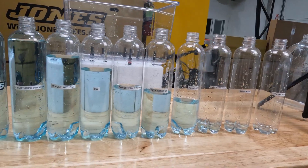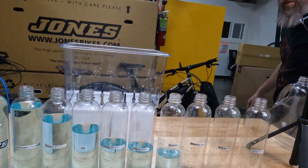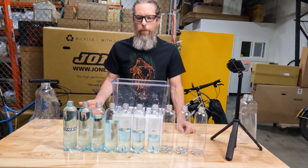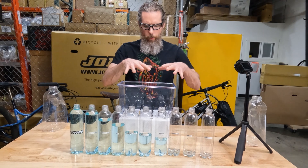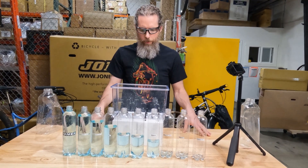When you're inflating a tire set up tubeless, it requires a certain punch to pop it open and make it fit — so flow really matters. That was fun and interesting. I'll be sharing more experiments to show how and why we do what we do here. I had done tests like this before on individual valve stems, but it was nice to have them all together at once and see all the results.